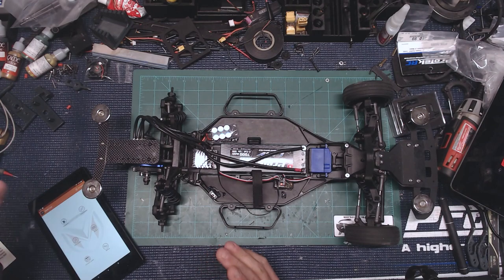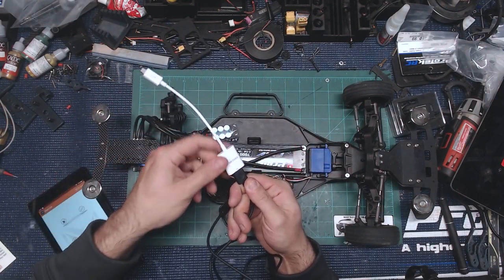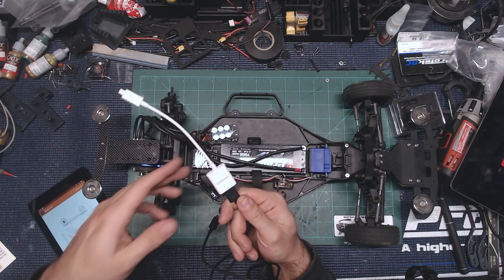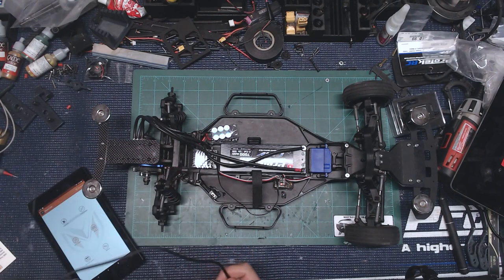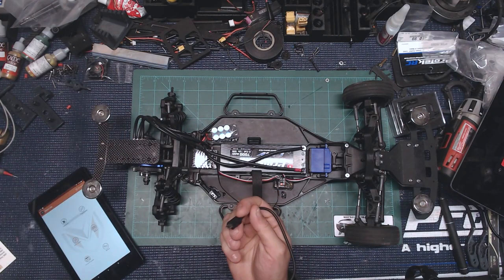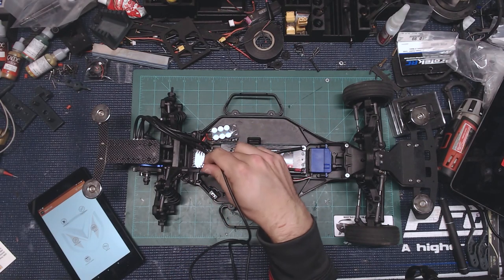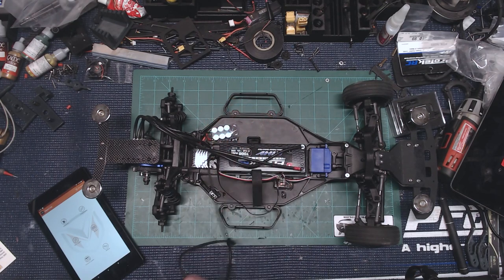What you're going to need is a regular USB wire plus an OTG adapter — a USB to micro — not one that just does charging but one that reads data. This one is from my girlfriend's old Samsung. One thing you want to make sure: this is the end that goes into the tablet, not the other end. That really threw me for a loop and I had to email Colin to find out what I was doing wrong.